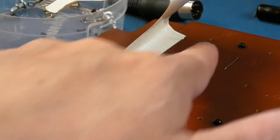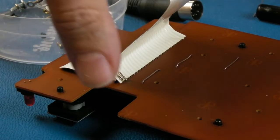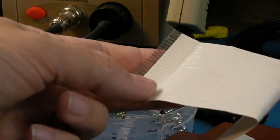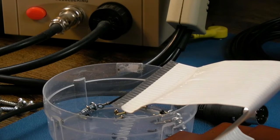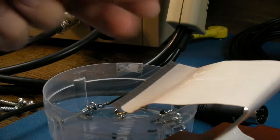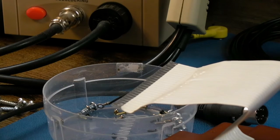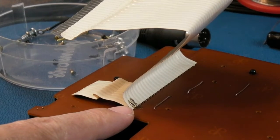One thing you could do obviously is just desolder all the things here, replace this ribbon with some, I don't know, some wire, like a multi-core cable type thing, a bit like IDE or something like that, something a bit more flexible perhaps, because IDE cables are super thin, isn't it? But then you've got the issue with the flat flex here that has to go into the motherboard. Yeah, what do you do about that? Well, Tom was of the opinion DuPont is something that people do, so have DuPont connections here, and then desolder the connector that's got the little springy contacts to mate with a flex ribbon like that on the motherboard, and fit a single pin header so that you can plug your DuPont in. But I just think that's way more complicated than just fixing the actual damage here.